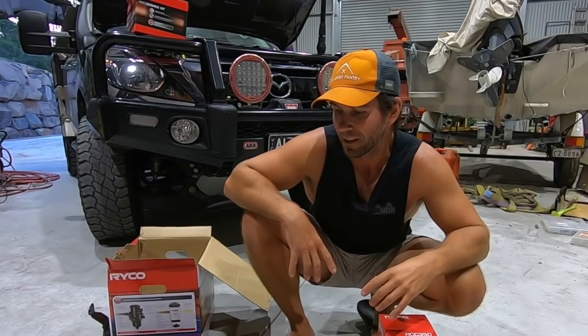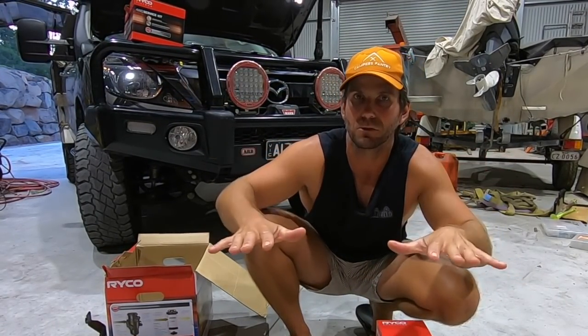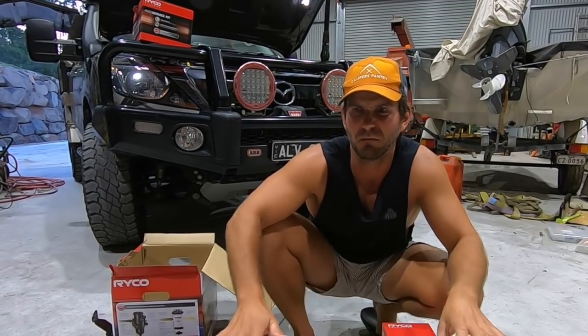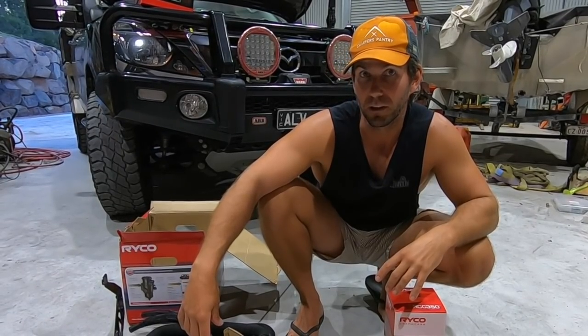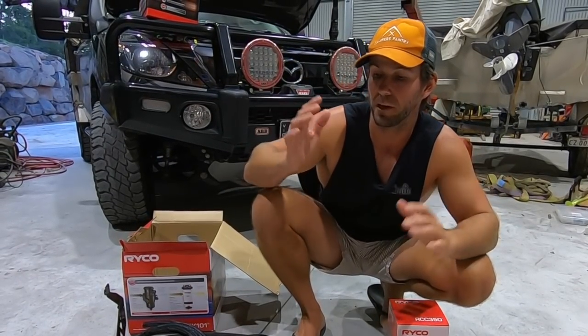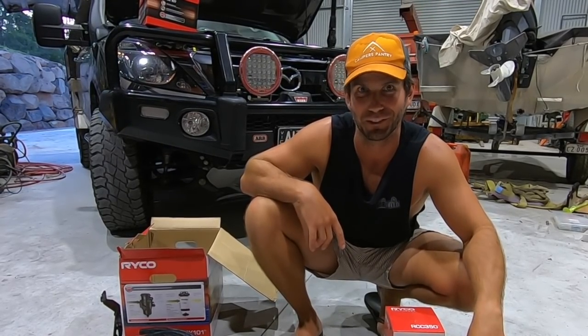But I just reckon, if you've seen water in diesel, overnight it all settles. The water's heavier, so all the water sits on the bottom. And I reckon you've got more chance of picking up water early in the morning. That's just my opinion. It's worked for me. I've never had dirty fuel. So anyway, if I do, I've got an extra filter now.